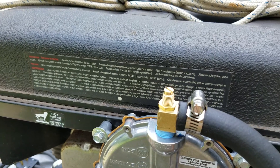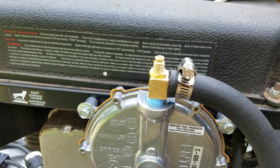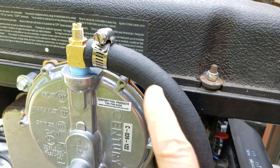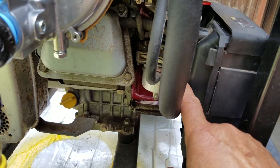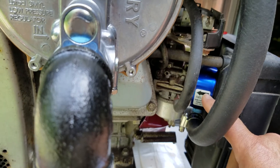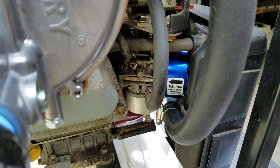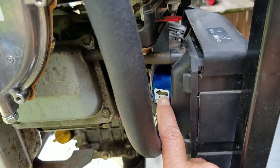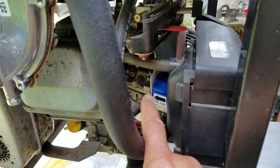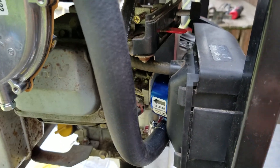This is adjusted after you get the unit running for the load you're going to have on it. It comes down this pipe, which is also included, through this little addition right here. Basically it's a donut with a venturi hole on the inside. You take off the air cleaner, put this on — there are a couple of studs they include to extend the studs from the carburetor out — put the filter back on and you're ready to go.